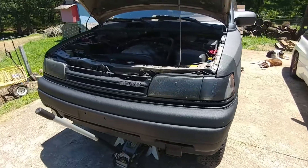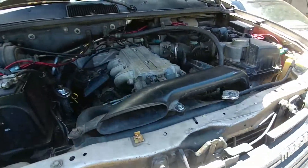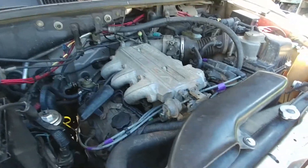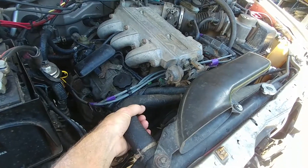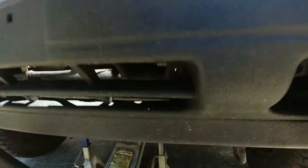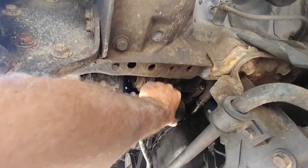The symptoms that I have is that the car is overheating and when you touch this hose it's hot, but when you touch the bottom hose down here, this was totally cold.